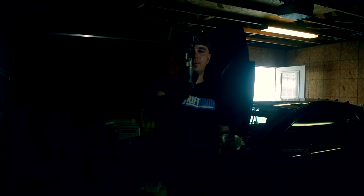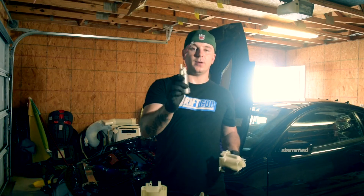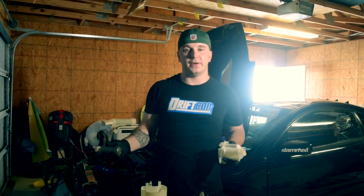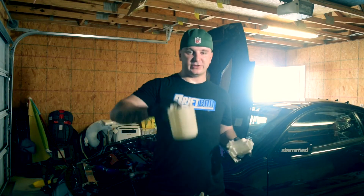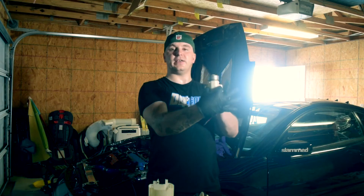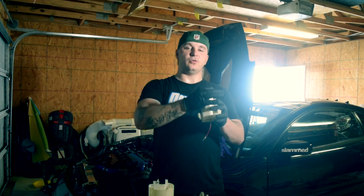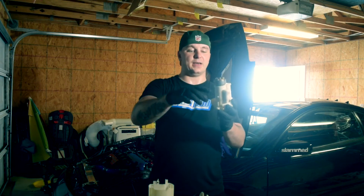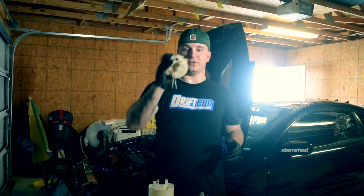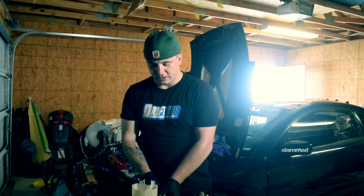Let's talk about fuel pumps. This is a 450 Walbro high-flow fuel pump. To push as much power as I'm going to be pushing, the 255 I have on there now won't cut it. The Walbro fits right into the surge tank — perfectly — the only thing is you have to modify it to stay in there, either with a zip tie or similar. The filter goes right off there, and you may have to modify some wires.